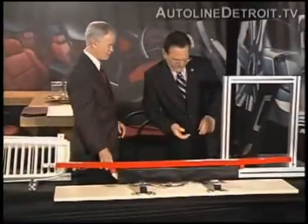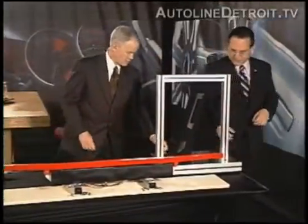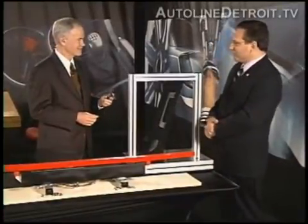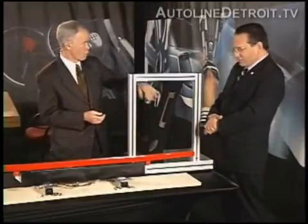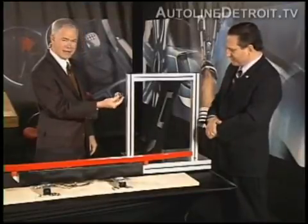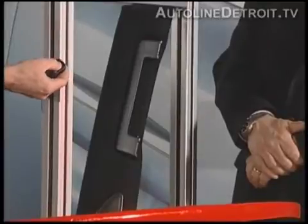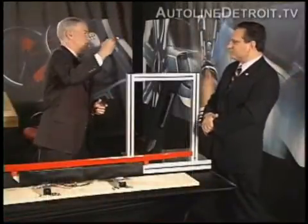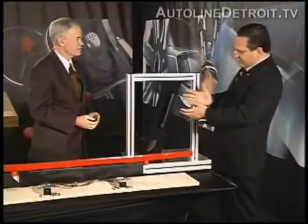Let's take a look at this last one. Take the key fob — imagine you're approaching the vehicle and you want to go in, and you're someone who likes to use the grab handle. This would be like the A-pillar or roof rail of a car, and you can't quite reach it. So I've got a key fob in my hand, I'm going to hit unlock — and kaboom. It presents itself to the person. I don't have to try to peel the thing off the A-pillar. We have all sorts of head impact and safety criteria. Packaging a motor to accomplish this has some challenges. We simply have a device back here that takes advantage of resistance heating of the wire, and we can do this.